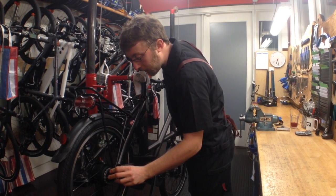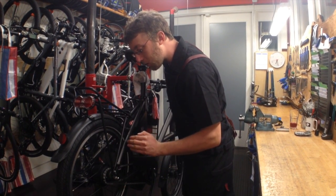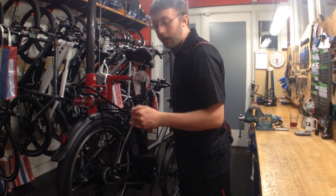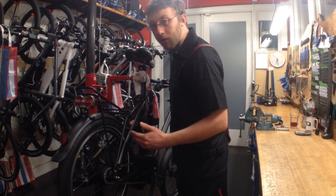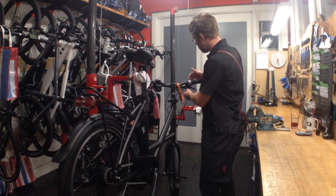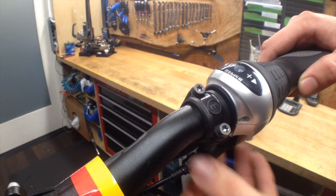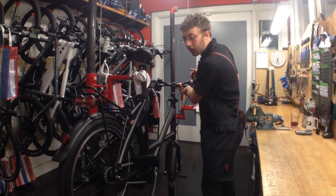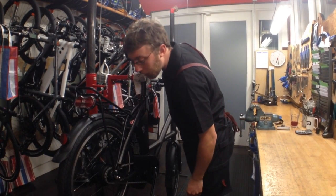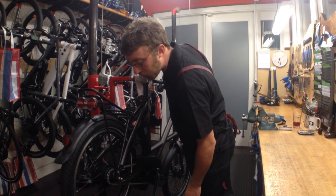What I'm seeing here is that the yellow line is a little bit further back this way, indicating to me that there's just not enough cable tension. If it was a little bit too far on the other side, that would mean the cable tension was too tight, and I would have to bring it back a little bit. So since it's a little too loose, I'm going to take the barrel adjuster here and turn it away from me — turning it in the counterclockwise direction. As I do that, I'm looking at that mark down there, and it's going to move just a little bit.